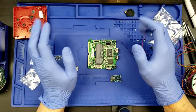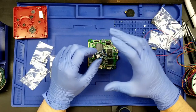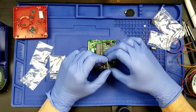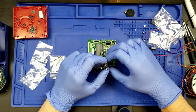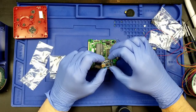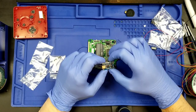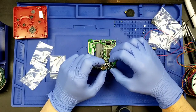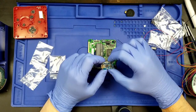Right up there. So that will be that. And that will allow us to charge with a not a fast charger USB-C. In fact, I don't even think that this will work with a USB-C to USB-C cable. This particular chip only really works on a USB-C to a USB-A type connection for charging. It will slow charge. I don't know. I may need to test this. If you do attach this to a fast charger, it may just charge slowly rather than quickly.